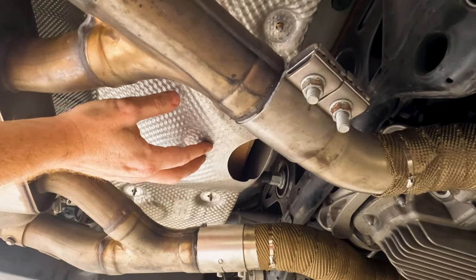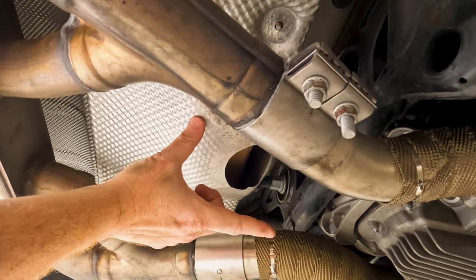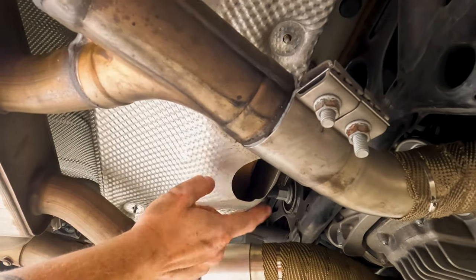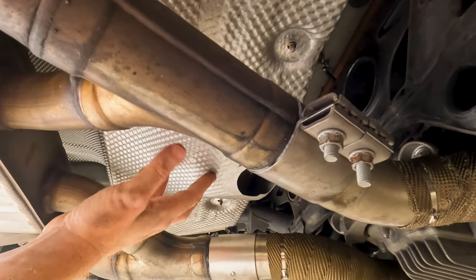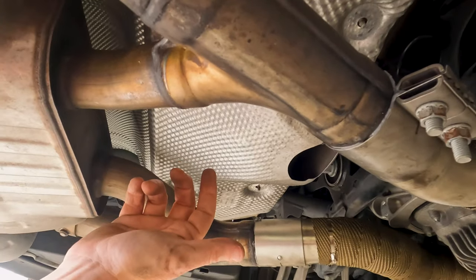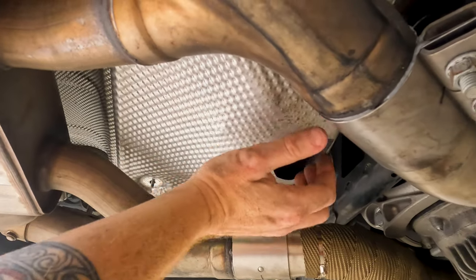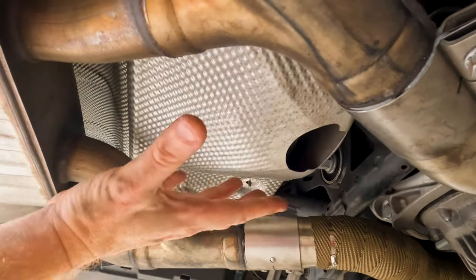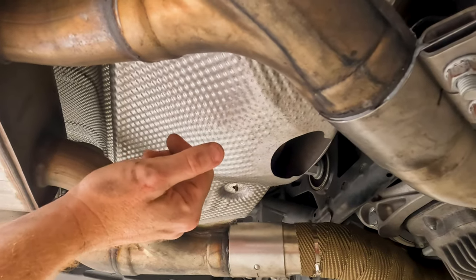As we roll towards the middle, you'll see your central heat shield right here — it's already a little loose because I took a bolt off. Notice there's a great void space right here, and there's an opening already in the heat shield. If we put the box behind this heat shield and pull the cables out safely, keeping them away from the exhaust pipes and routing to both sides, it's going to be absolutely perfect. The box is waterproof, and in this location it will be shielded from rocks, radiant heat, and any other damage.